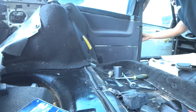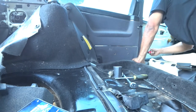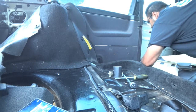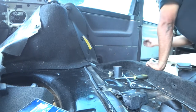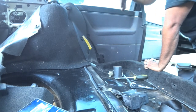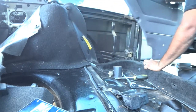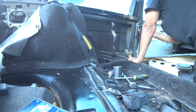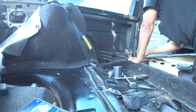Pull your weather strip back a little bit and take these two screws off. Once you take them off, you're gonna put them back on but without the door panel and rear panel. You're gonna pull out and up just like that — these little covers or latches — pull it straight out just like that. When you're done, put your little screws back on that way you don't misplace them.